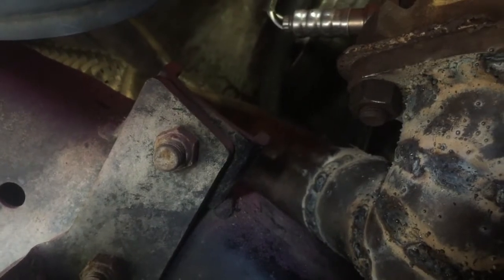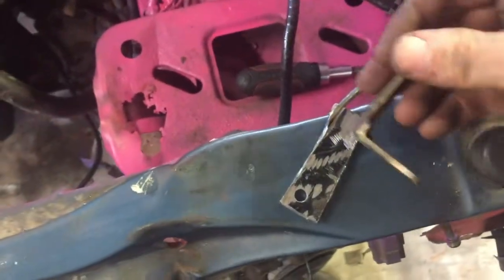From the top you can't even see it, and I was able to bash in that side just enough to clear the frame. It dumps out down here. Now I'm working on making a bracket to mount the throttle cable. The throttle cable that came with the truck is a pretty good length — maybe a little long — but because I have to come around the side due to turning the throttle body sideways, it's pretty much perfect. I'm making a bracket to bolt on down there and welding the OEM bracket to it so I have adjustability.